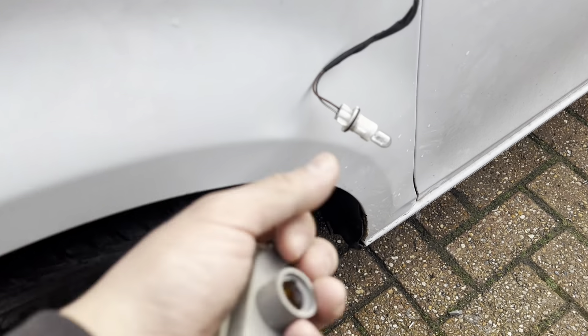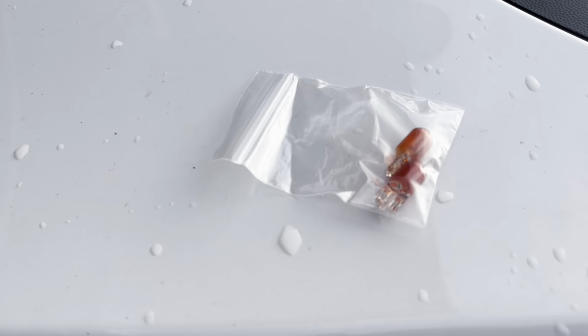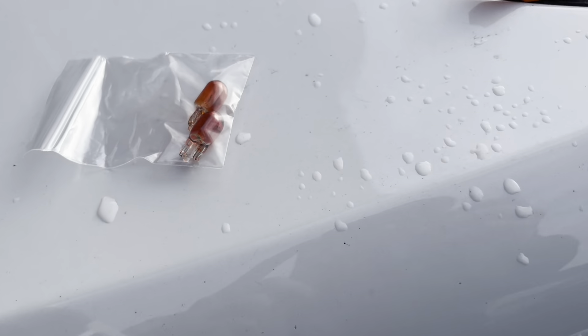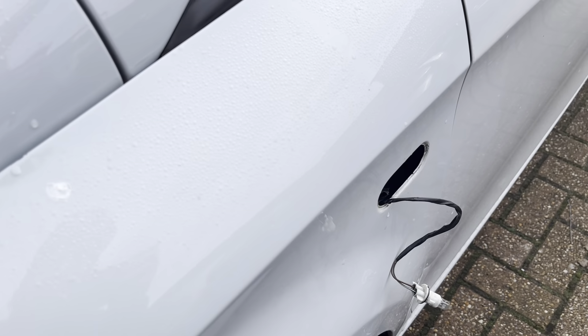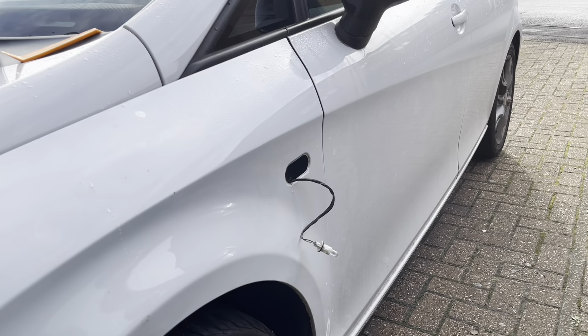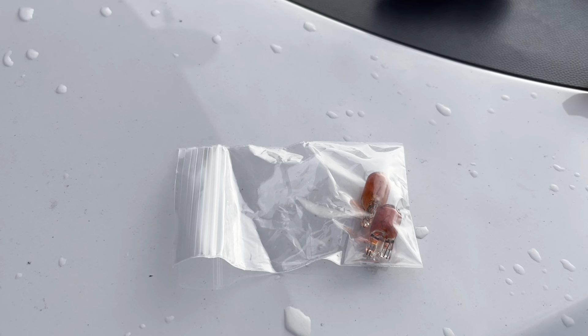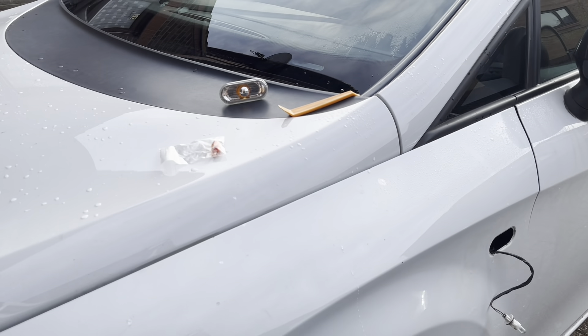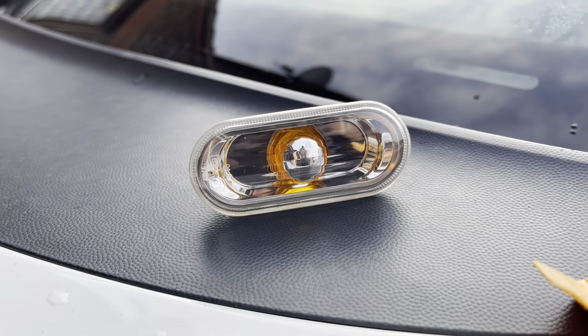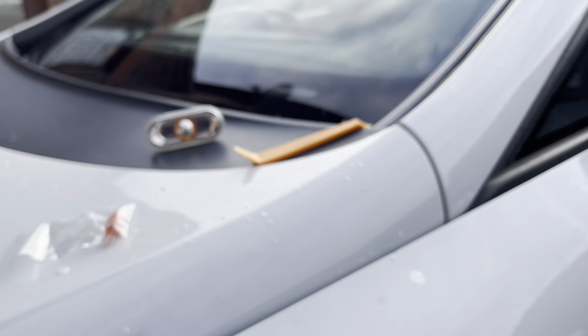In this video we'll be changing the 501 bulb, the clear one, to an orange tinted 501. In one of my old videos you might have seen that I put dynamic LED indicators in this car, but that was removed because the error arrow kept coming up. So we went back to stock 501s, but in this video I want to see if there's a difference putting tinted ones in - if it's more orange or if it's the same - because obviously the original indicator has an orange type of plastic in it to make it reflect orange.